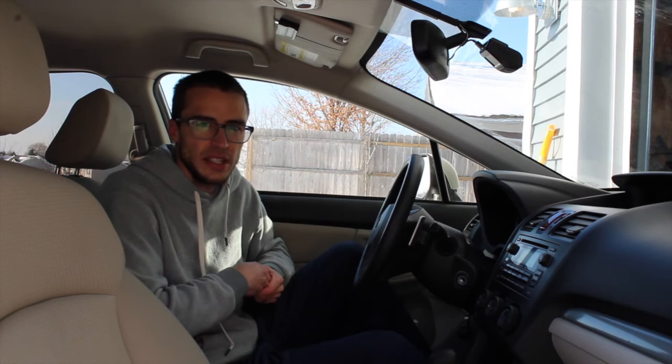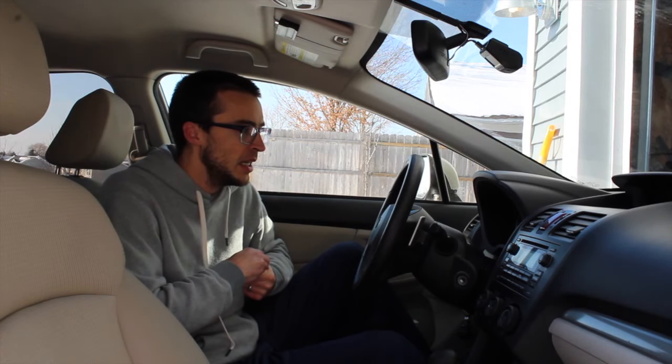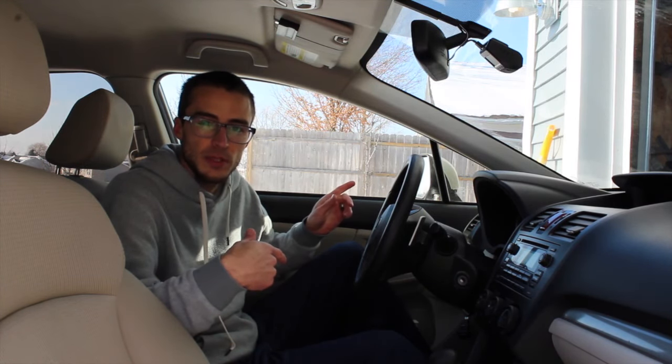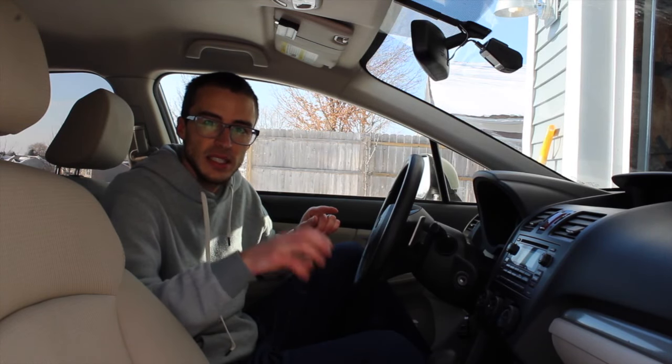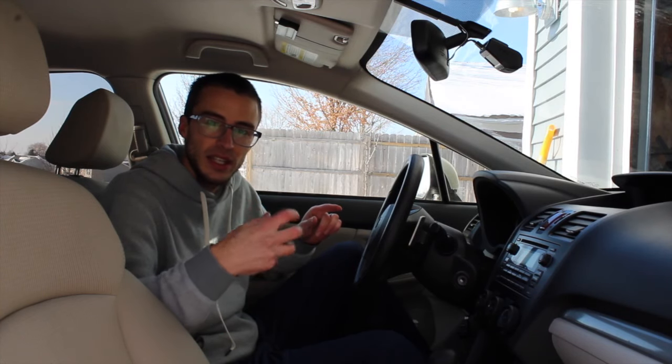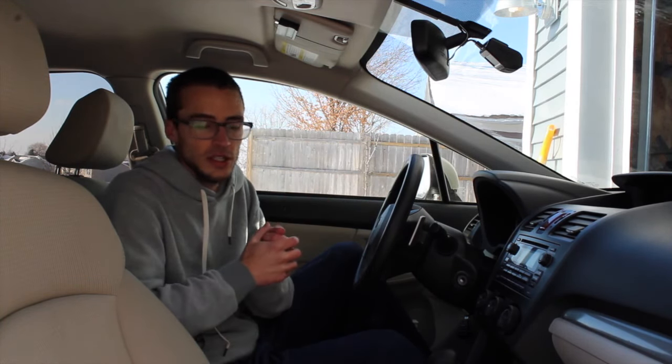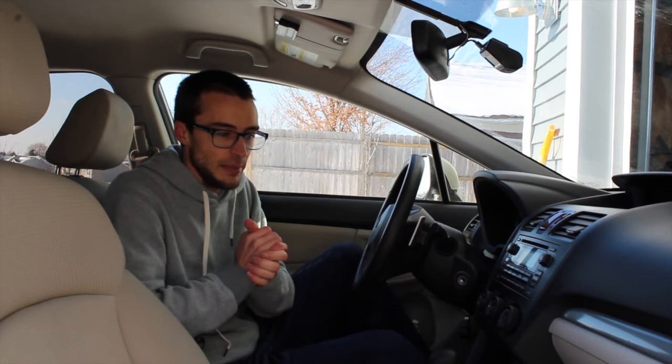I couldn't really tell the difference between those two, which was good. The one thing I did notice with vehicle dynamics control, ABS, and traction control off when I pulled the fuse: these cars have open diffs on the front and back, so if one wheel starts to spin, it keeps spinning and the other wheel won't spin at all. What the ABS system and wheel speed sensors do is detect slip on a wheel and put the brakes on that side so the other side with grip can spin. When you turn off VDC and ABS, one side with less traction just spins and the other side sits there and doesn't move at all — and that made the biggest difference in this test.